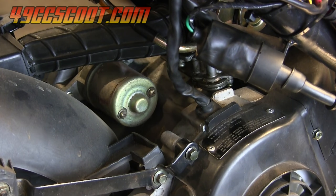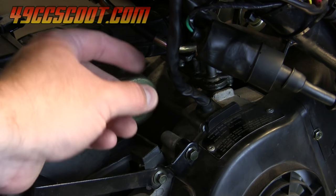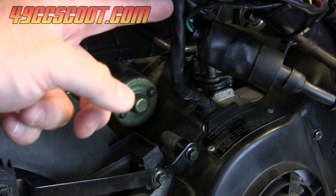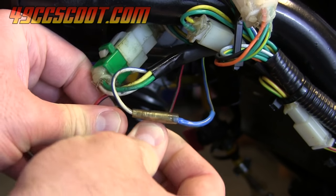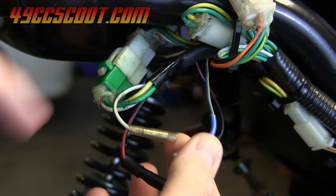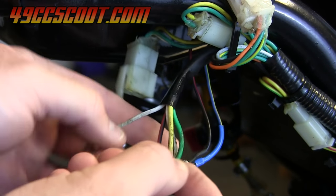If you're not sure where to find that bundle of wires, the easiest way is to look at the right side of your engine just above the flywheel and fan. You should see a set of wires coming out of the engine — just trace those and they'll lead to the group of wires I was talking about. Once you've located them, go ahead and disconnect each of the connectors: the red and black or black and red, the one from the pulse or pickup coil, and the large connector for the charging, lighting, and grounds.